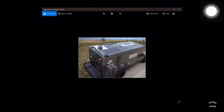Anyway, I noticed that they use these boat vents on the back, at least that's what it looks like to me from this angle. I think if I looked close up, that's exactly what they'd be, so that's what I used in my project. What I didn't say is they use a refrigerator vent for the top, for the intake of the air passing over the condenser. They used a refrigerator vent to suck air in, and then an exhaust through these vents right here. But I just wanted to pass that on to you in case maybe it'd be useful to somebody out there, especially if you're going to mount it on top. That would be an arrangement where I drilled holes in the bottom for my intake.